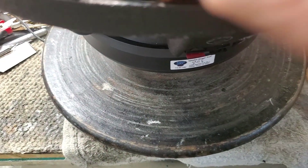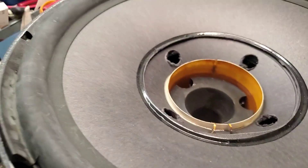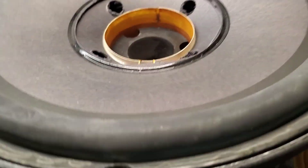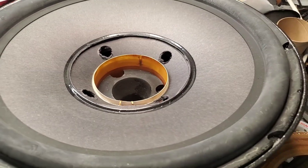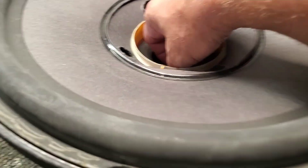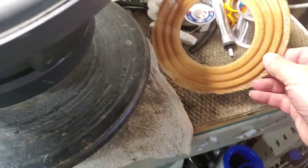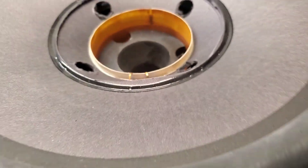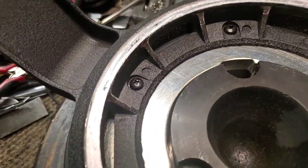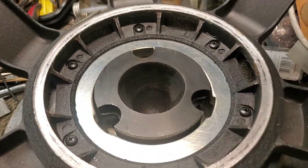The first person that tried to get it apart tore the surround right there, so I've patched it with some polyvinyl acetate and that should hold up reasonably well. Since this one came in, I've subsequently had another one come in with the same problem. To make a long story short, there was a bulk purchase of these by Parts Express and a bunch of them started to fail with the same failure mode — the spider coming unglued. It took me an hour to chisel away the surround. The next step is to clean up the frame at the surround landing, and I've already done the spider landing.